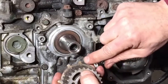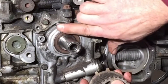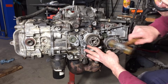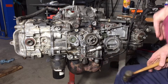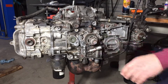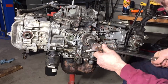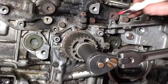There's a timing mark right there, and the other timing mark is right there on that — it's got to be a position sensor or something. We're just tapping the main gear onto the shaft; it wasn't really that hard, just a little burr I put on there. I know for a fact the valves are all fully closed, so I'm in no danger of ruining anything by turning it.